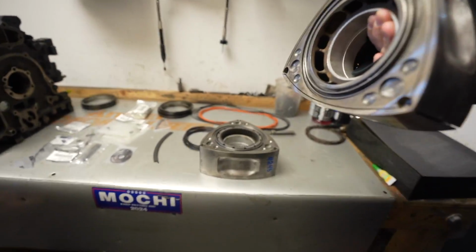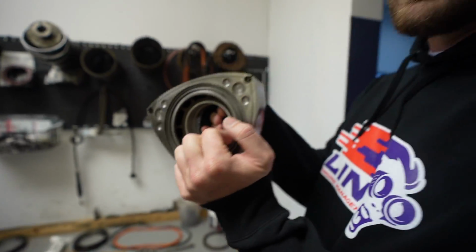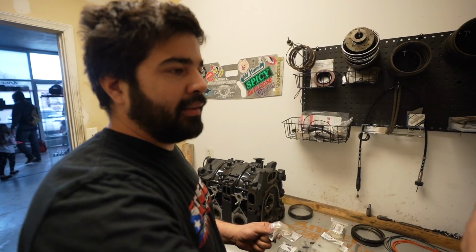Let's get these rotors together. Since we have a 13B, it is just a 2-rotor engine, so we have both rotors right here. Vargas pressed new bearings in the inside here. See all those big juicy bearings. They were balanced, and the sides were shaved, weren't they? Yeah, they're race clearance, just to keep them from hitting the plates at high RPM.